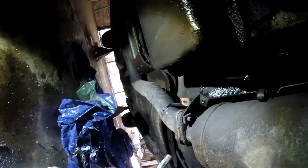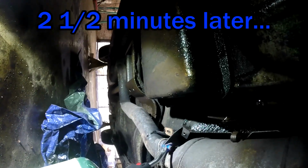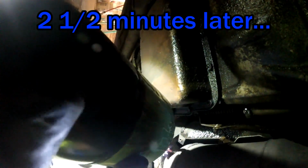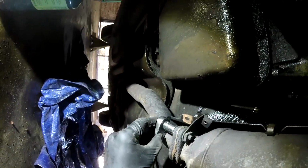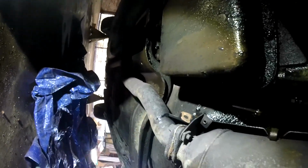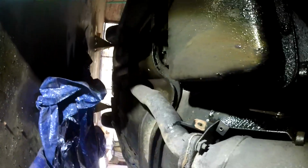Another safety precaution I have at the ready is an air blow gun. If the fire is small enough, you can just go pss, pss, and blow it out real quick. And since this is a bolt and a nut style with just a hole, another method would be just to break it out on purpose, beat it out with a punch, because that is one piece. I may resort to the barbarian method.